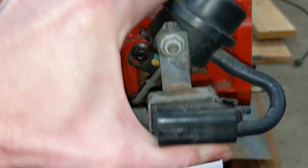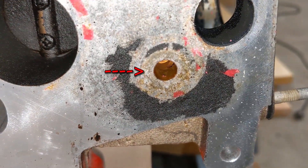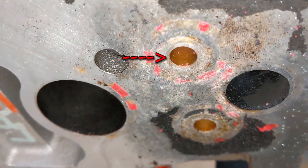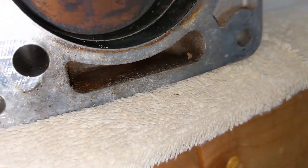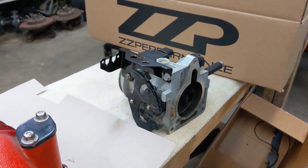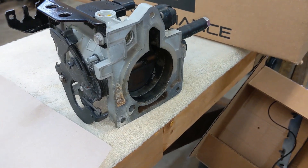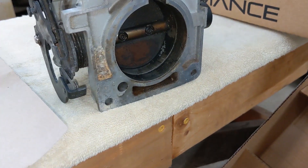Here's the supercharger — on the bottom it goes in that hole, and then it comes out the front of the supercharger where the throttle body connects, and then it goes back in that hole, and then out this hole back down into the manifold. It just runs through the throttle body in that little cavity, and that's to heat it up — these cars were driven all over the United States, and some of these would be in frozen climates, 20 to 30 below. GM had to be sure that these wouldn't freeze up and cause accidents, so that's why it's there.